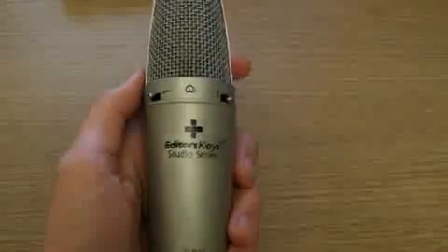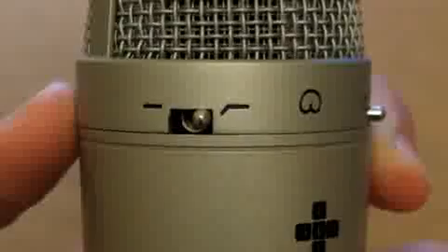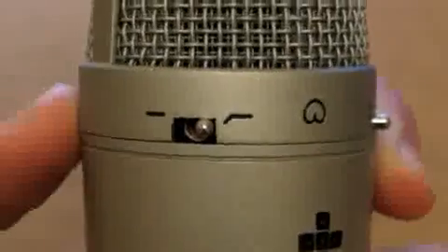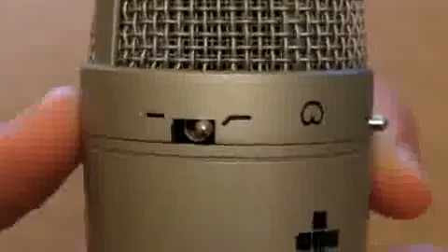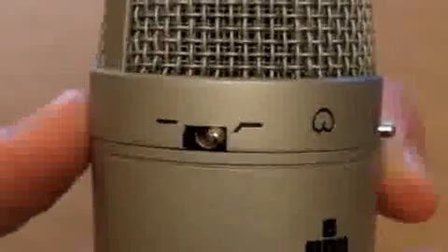As you can see, it has two switches — one on the right and one on the left. The switch on the right is the sensitivity control. You want to select the minus 10 decibel setting if you have a lot of background noise in your room. However, if you don't have any background noise, simply select the zero. The switch on the left is to switch between omnidirectional and normal mode. Omnidirectional picks up a lot of sound, and normal just means that you have to speak directly into the microphone. If you do not speak directly into the microphone on normal mode, then it will not pick up enough sound.